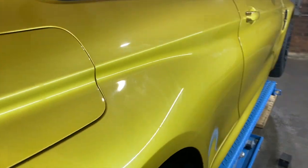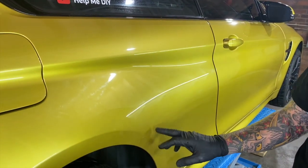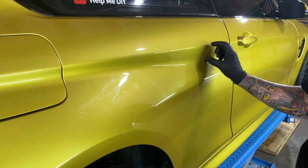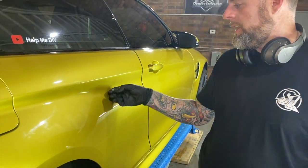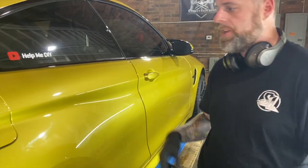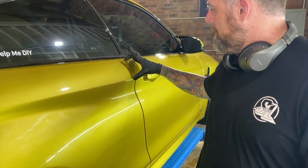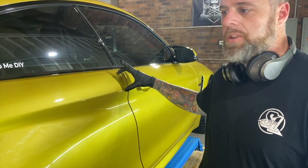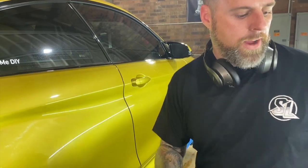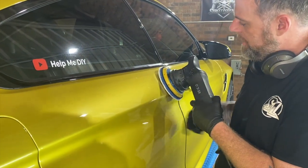And you're kind of trying to avoid edges and stuff as you go? Well, you have PPF, and I don't want to dig that in. Right. As far as this goes, this is going to take a different kind of machine. You can work it in like this and get half of it. But the top part is going to require a smaller one if you're trying to go, again, for perfection. But we're doing a coating, so we kind of want to. Technically this is 3 inches, so I'd have to use a 3-inch pad to do this. This is 1 inch. I'd have to use a 1-inch pad for that. So theoretically, if this is all you had, you can make this work, but you're hanging off here and you're hanging off here.